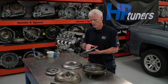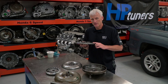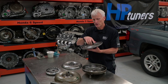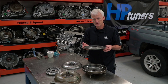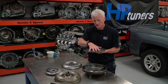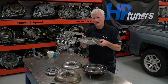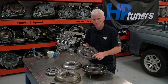Another issue he mentioned is a back taper machined into this piston assembly, so the outer edge contacts the cover first. As pressure builds on the applied side across the full surface area — leveraged off the lining toward the outside of the piston — it causes the piston to flatten out. If you overpressurize it, it's going to curl up and create excessive contact on the inside surface of the friction lining.